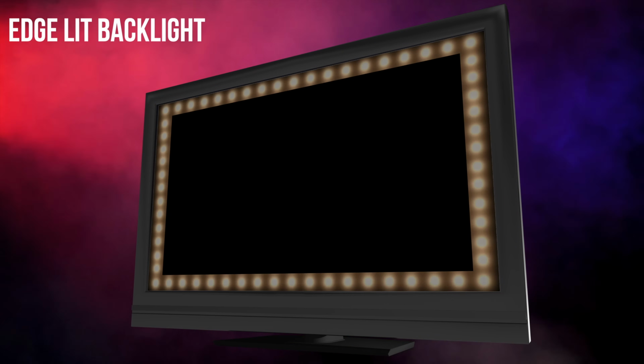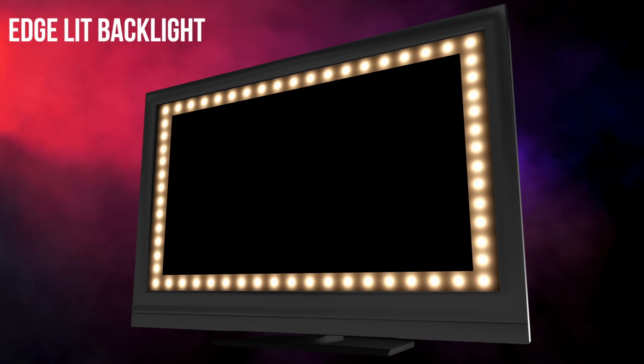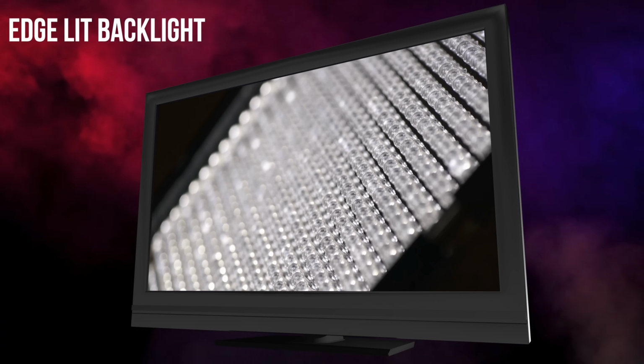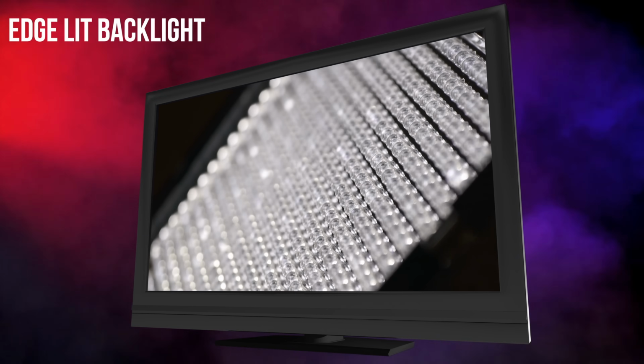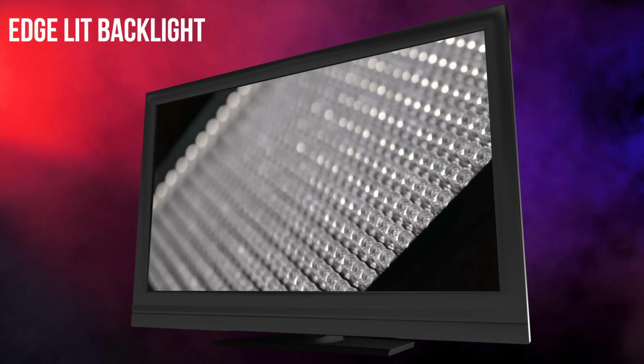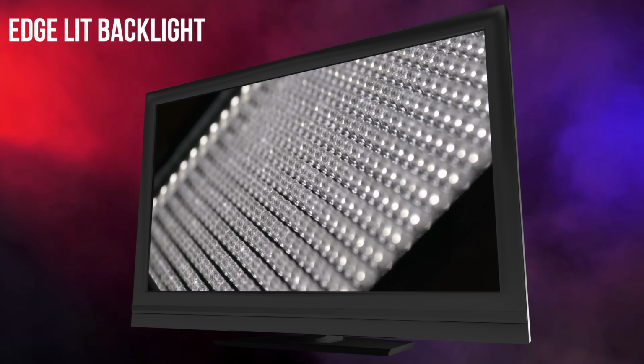But what is an edge lit backlight? Let me explain. The TV is gonna be thinner and lighter at the expense of some picture quality. And what I mean by that is that since the LEDs are around the edge of the television set, the center of the television set is not gonna be as uniform with the picture quality. In fact, you're gonna get more gray whenever you're watching any type of dark scene movie. However, Samsung does have a technology called UHD dimming that helps this television set achieve a better contrast ratio. But we'll just have to wait until I do a full review to find out.